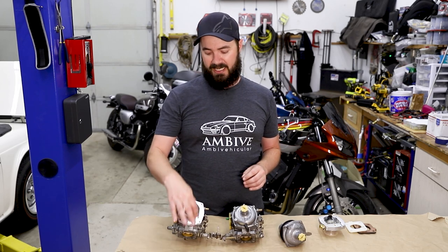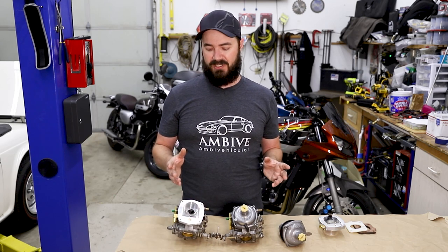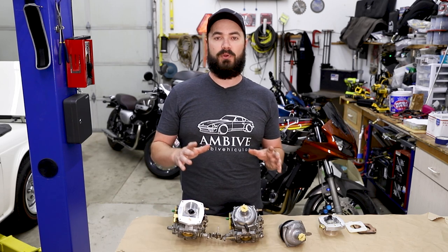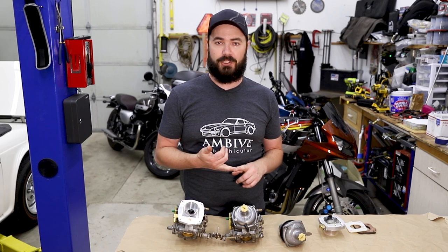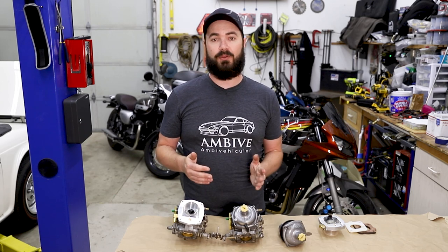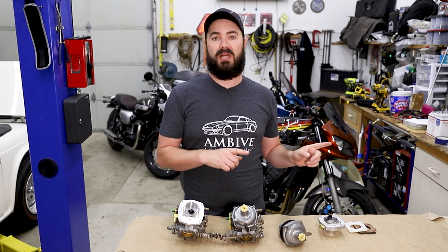The more complicated part is deciding on your wiring route to make sure you don't run into any heat sources, and adding in the fuel system. With a fuel injection system, we're going to have an electric fuel pump serving a lot higher fuel pressure, and we're going to need a fuel pressure regulator holding back the right amount of fuel pressure for these fuel injectors, and a return fuel line to the fuel tank.